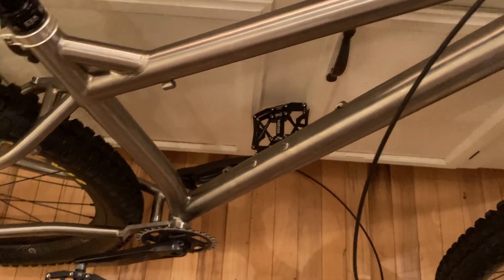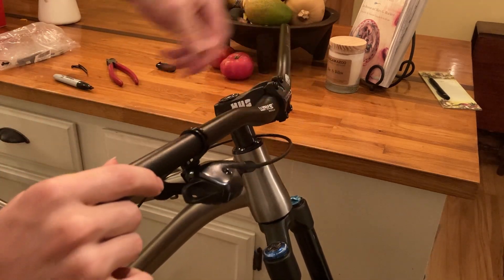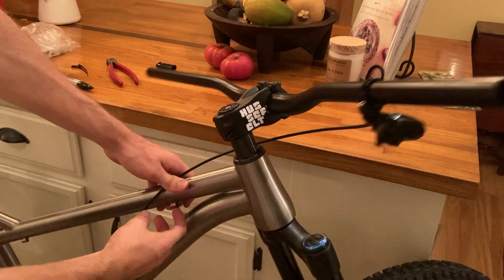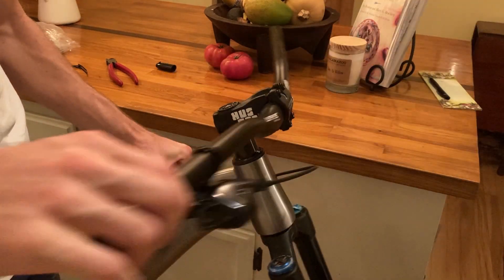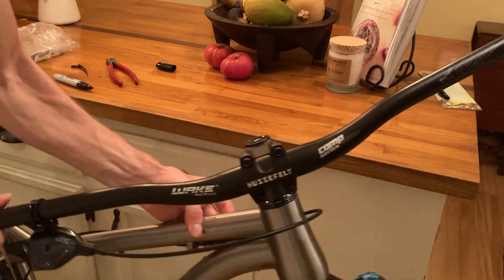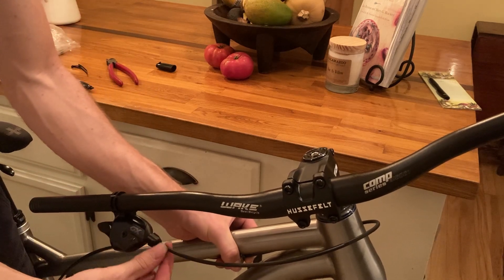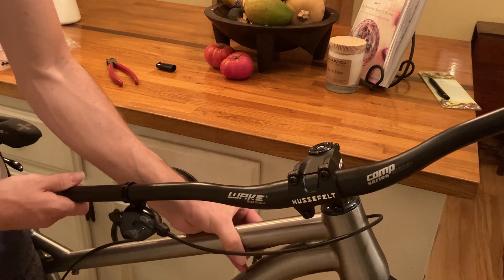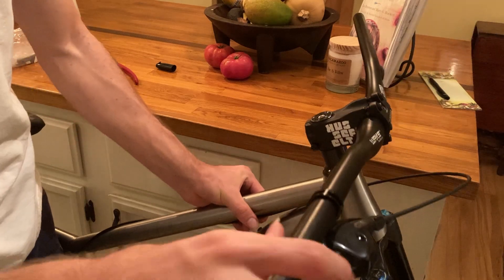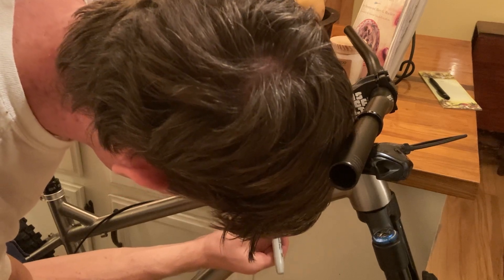Now I'm going to show you what we need to do to take all the measurements for external cable routing, then cut everything to length so we can get this cable back at the rear derailleur. To make the first cut, measure the cable housing from the shifter down to the first frame mount. Turn the handlebars all the way to the right until nearly past parallel with the frame, hold the cable against that point, then turn back to center and make a mark with a sharpie where the cut needs to happen.